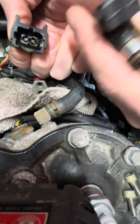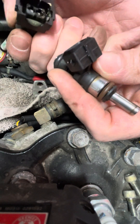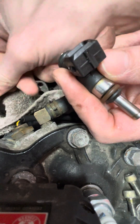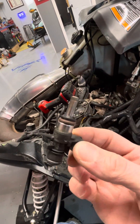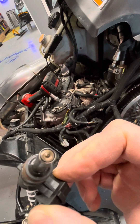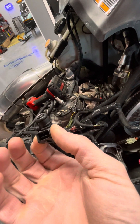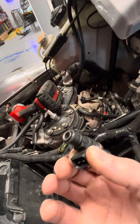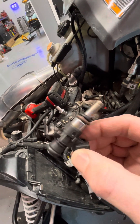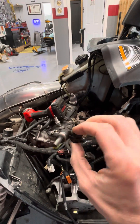There's a little bit of epoxy in the connection. I'm going to take these down the road and have my neighbor put them in his injector cleaner and tester. We're going to check the flow rate, make sure they're flowing equally and flowing well, and give them a clean if needed. Make sure you label them when you take them out — I took out the mag side, so I'll label it mag side and make sure it goes back there. Hopefully that helps you guys take these injectors out if you're working on a 600 CFI Polaris.